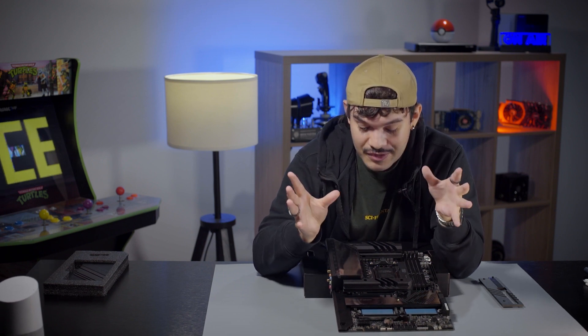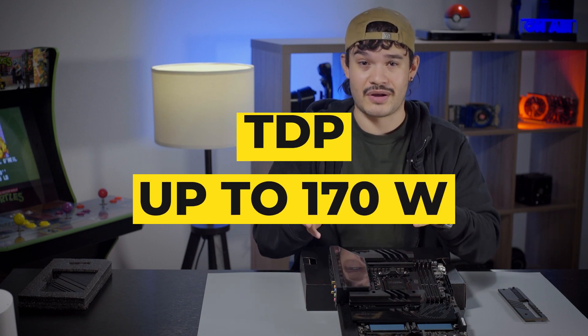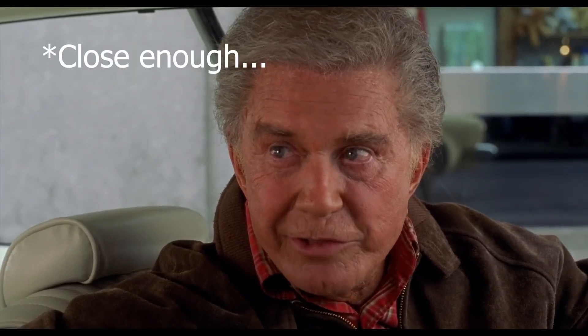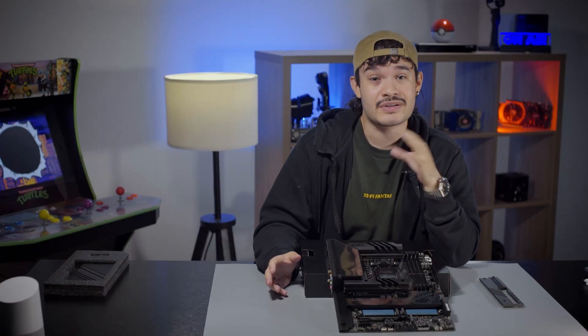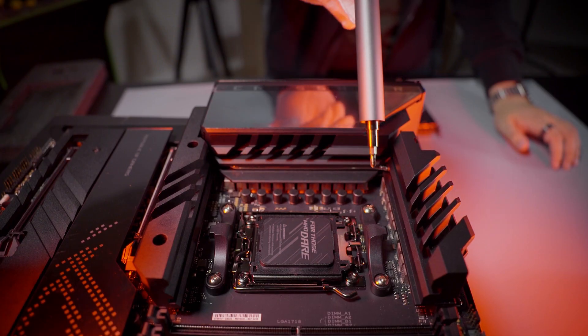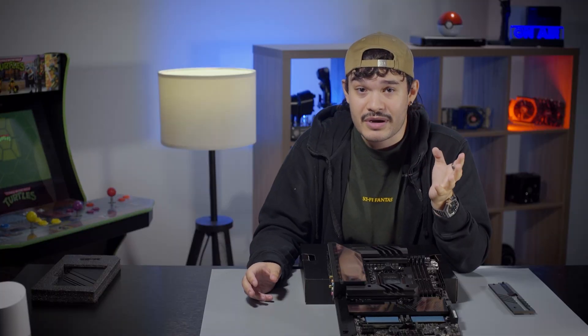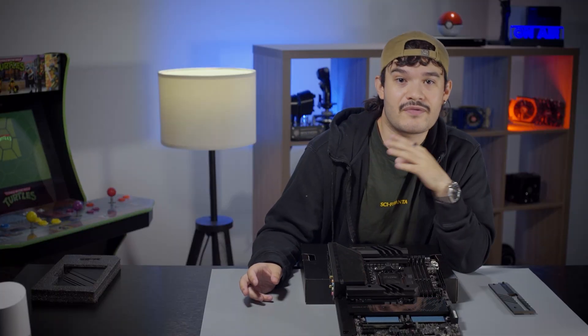Now taking a general look at the Hero, some of you are really wondering what some of the amazing highlights of this board are. The new AM5 chip, depending on which one you get, has a TDP of up to 170 watts. With all that power, it needs proper cooling — with great power comes great responsibility. Rest assured, you can adapt your AM4 coolers to AM5. The Hero bears the same mounting hole alignment as AM4 platforms, so it is backwards compatible with your existing coolers, with less than one millimeter of difference between old and new chips.